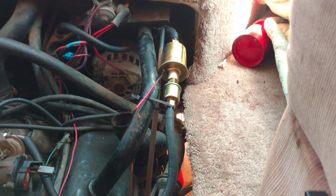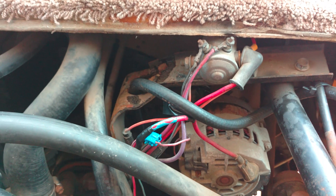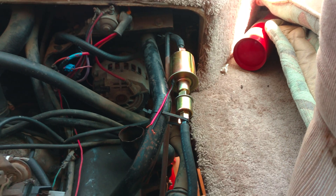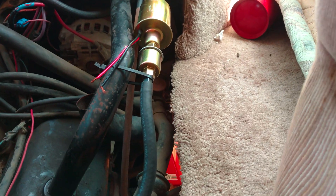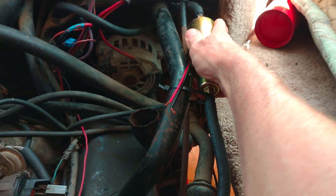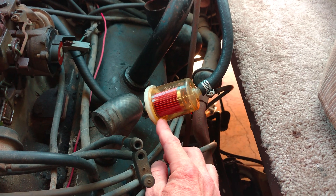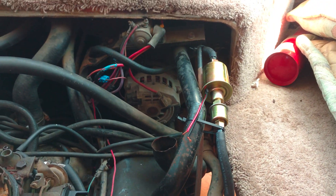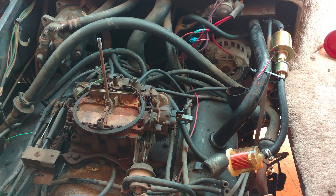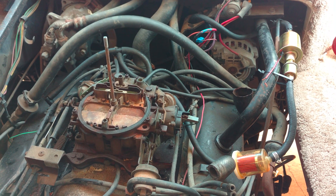For now, to move the vehicle, I had to run this line into a gas can to drive home because it was stuck on the street. And it worked great. That's my new system now — it's wonderful. You can see it, you can get to it, you can put your hand on the pump to feel if it's working. You can see if you've got gas; it should be all filled up with no air.